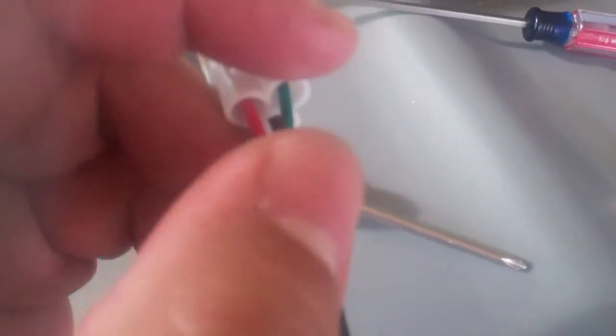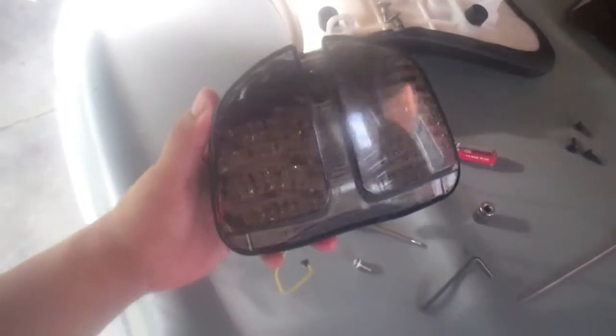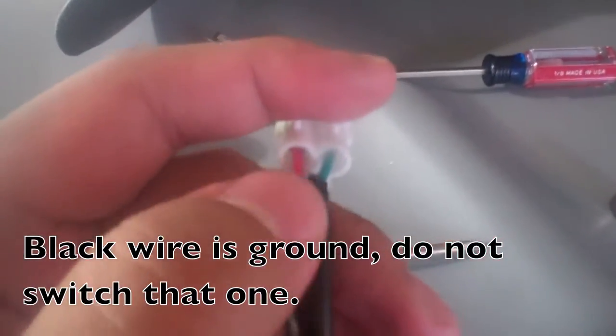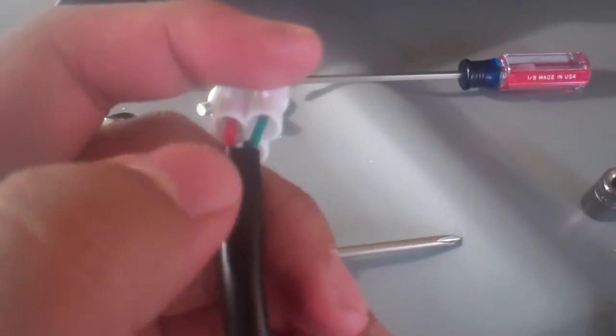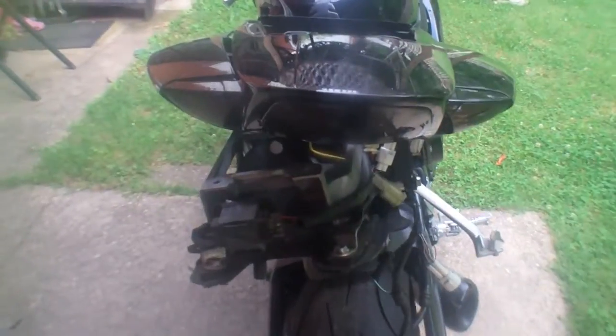These things right here — you see the green and the red. At first they were switched: the green was here and the red was on the side. When I installed it earlier they would work, but the brake light — when you pull the lever — it wouldn't light up, it wouldn't get brighter. I read on the forums that you have to switch the wires around, so I swapped them, plugged and played it, and it worked. I'm excited!